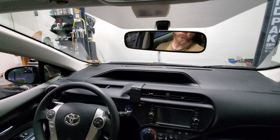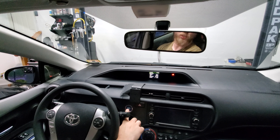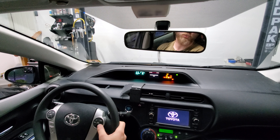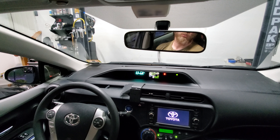Now that we've performed our maintenance, we need to reset the reminder that appears when you cycle the key on. First get the trip odometer showing, then key it off. During the car animation at startup, press the trip button three times and hold on the third before the animation completes. One, two, three. As you can see it's counting down — at the top left of the maintenance screen it says 'resetting maintenance data.' And that's it. Turn it off, push on the brake pedal, power it back on — no more notification. The service is complete.